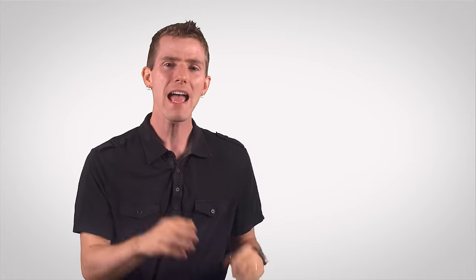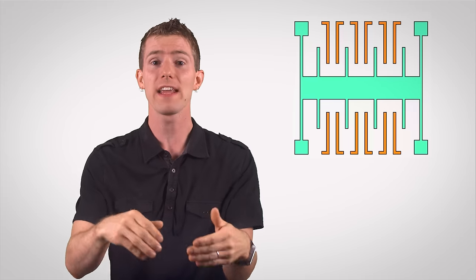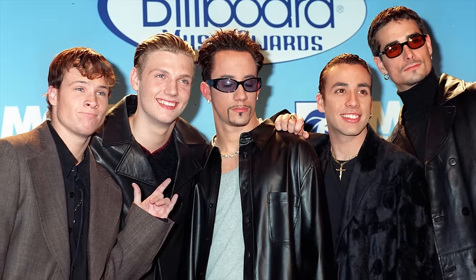So let's say "Shake It Off" starts playing and you're frantically shaking trying to shuffle your playlist. The mass's position relative to the electrodes will change thanks to inertia, changing the capacitance between those electrodes, which your phone interprets as a shake — and suddenly you're listening to some even more deeply embarrassing song you forgot was on your phone.